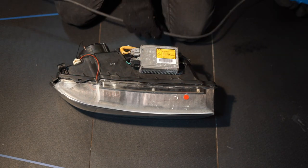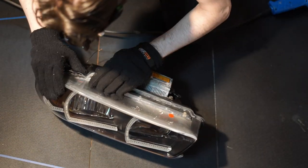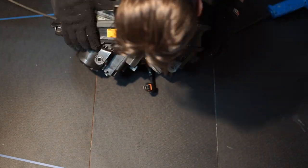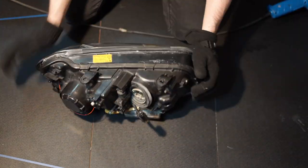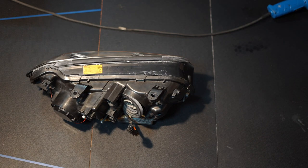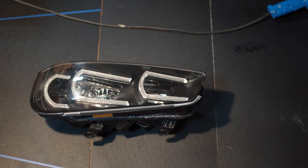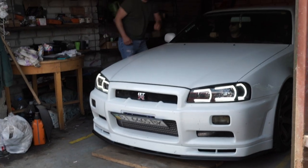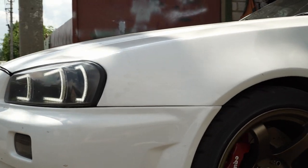Secure your glass with the two holding screws that we removed in the beginning and apply the holding clips. After that you will be ready to install your headlights on the car. Use a T10 bulb socket to connect the marker module electronics to the bulb socket on the car. Basically, that's it — your daytime running lights are installed. Your lights will work as parking lights and will be powered once you enable your parking lights on the car.